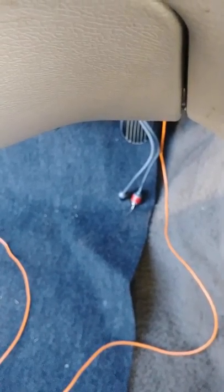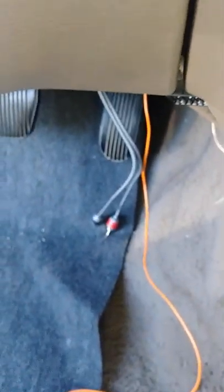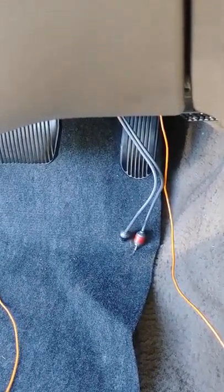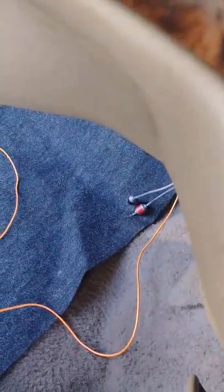We're back — that was a little more difficult than I thought, but we did it. You can see we got our power wire and our remote turn-on wire, and we got our terminals. We're going to go ahead and run the wires from in there down through here. I already got the remote turn-on wire ran down through there — you can see that — and now we're just going to get the steering wheel up.